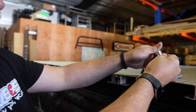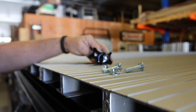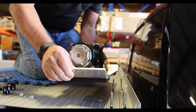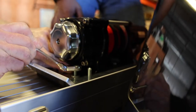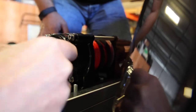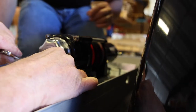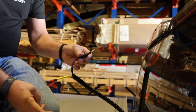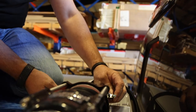Installing the winch: the hardware in the winch box includes two carriage bolts with nylock nuts and two knobs. The knobs go in the back; the carriage bolts with the nylocks go in the front. Take your winch, put it on those bolts, and tighten down. With the nylock nut, just snug it up to where the winch can still slide back and forth — that's what you use the knobs for to hold it down. Your yellow and blue wire hooks up to the winch, and the winch will be color-coded red and blue. Simply hook up your colors and you're good to go.